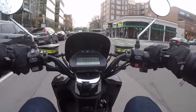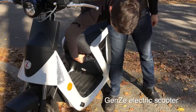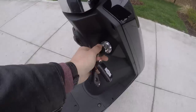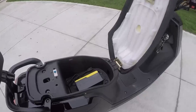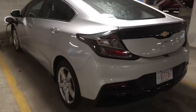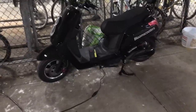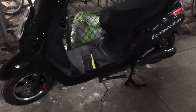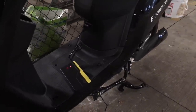The biggest bummer in the scooter is probably the lead-acid batteries. They cannot be removed for charging, like other electric scooters with lithium-ion batteries — you have to charge these batteries on the scooter, which means you need a ground-level outlet. I live on an upper floor in an apartment building, but fortunately I found the only 110-volt outlet in our parking garage and ran a 75-foot extension cord to charge it. If you have your own private garage or access to a ground-level 110-volt outlet, you should have no problem charging the Bloom Scooter. But it could be an issue for apartment dwellers that can't find a creative solution.